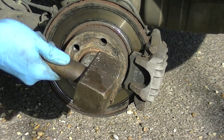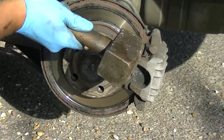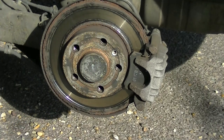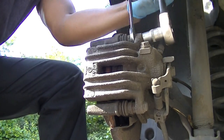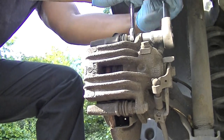Give the rotor a little knock because it's rusted and everything is sealed under there. Loosen the locating screw — it's pretty simple. You're lucky if it comes out easily, and I was lucky. Once you've got it off, you need to loosen the nuts behind the caliper.